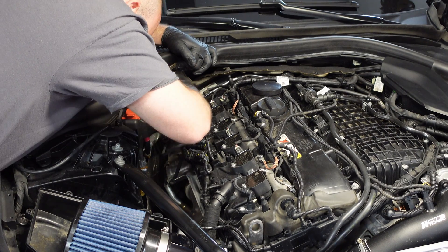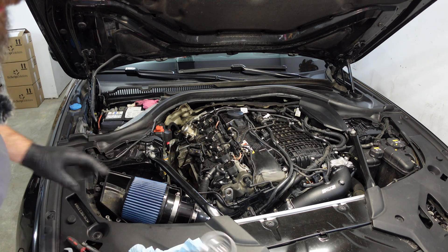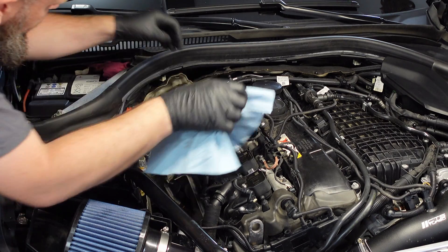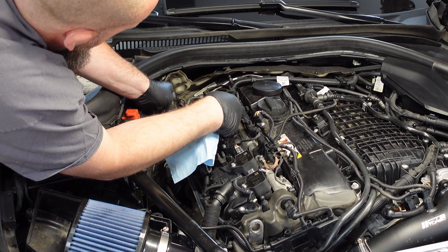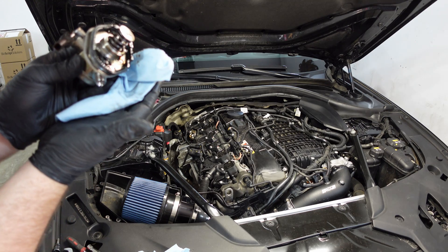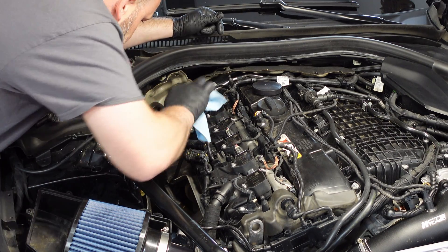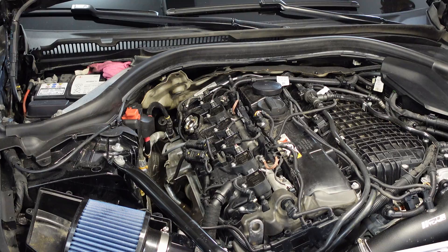And that's some fuel. There's one — it's feeling pretty light. It is a steel bolt, so just be a little bit careful when you go to put it back in, but you can definitely reuse that. I have my clean paper towel here. The hard line comes out — this will just come straight out. That will go with the old gasket. You can see the gasket and then the lobe that the spring rides on the cam. Let's make sure everything looks good. We're going to give it a quick wipe with the clean rag. At this point you can do a little bit of an inspection. Cleanliness will be key because you want it to seal up and not drip oil.